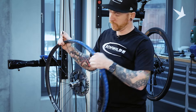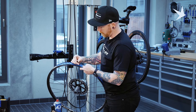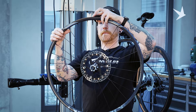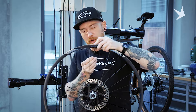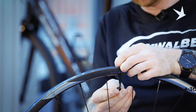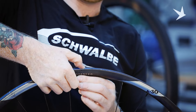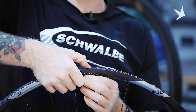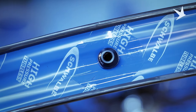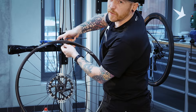A little mark like that, remove it and you can see a little dimple in the rim. Then put the valve core over the little marker and you should just be able to push it through with your thumb through the rim like that. Firstly, put the rubber washer on. This will protect the rim from the threaded washer which tightens the valve. Push a little bit of pressure on the top of the valve as you're tightening up, just so it tightens fully into the rim bed. If you feel that you need to tighten the valve up further on the rim, there's a 4mm Allen key hole in the top of the Schwalbe valves. You can place an Allen key in it to hold the valve in place so you can tighten the valve up a little bit more by hand.